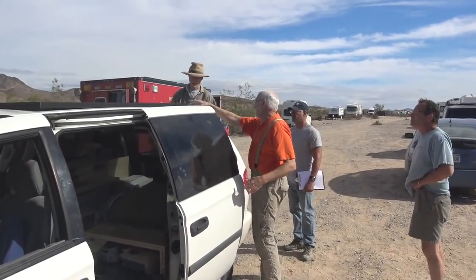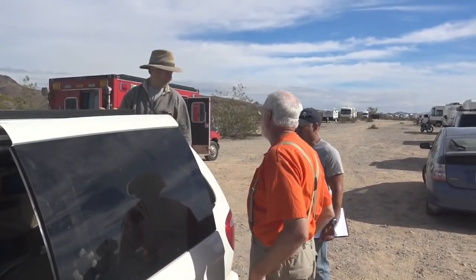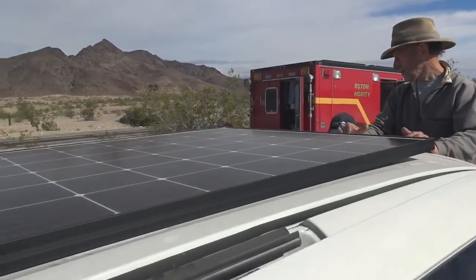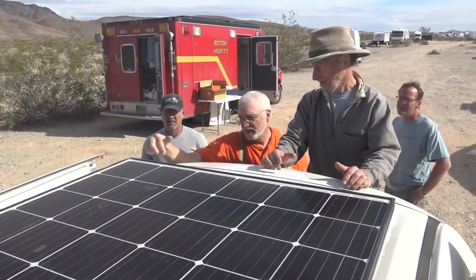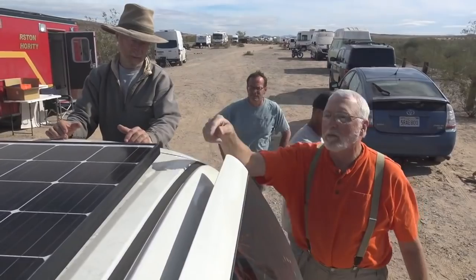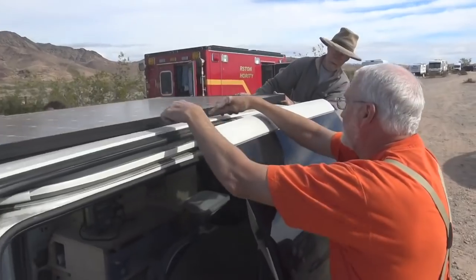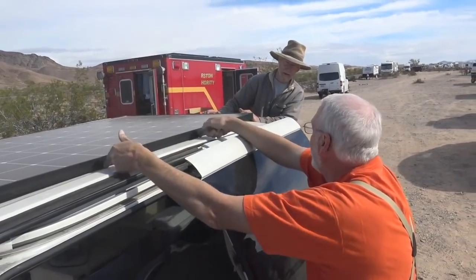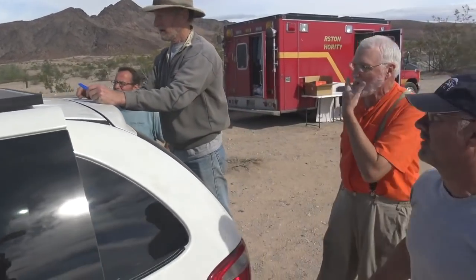Your gland is going to go back here, or the other side — wherever we're going to come in. If we decide where we're coming in, you want to do it right here and then run the wires down this way. The more to the side it is, the better. My suggestion is, with this thing sitting up there, mark the points on the roof that seem to be within that relatively flat area — that's where we put the brackets. Also make sure you're in between those ribs so that doesn't mess us up.